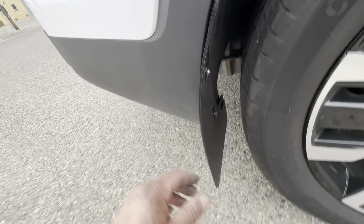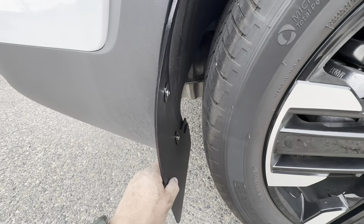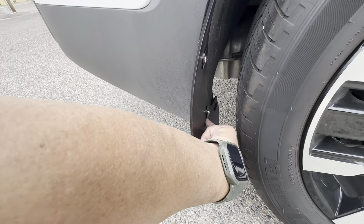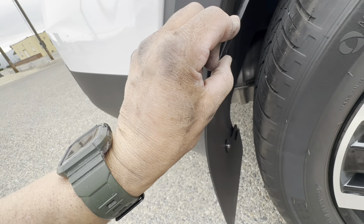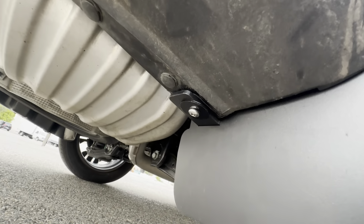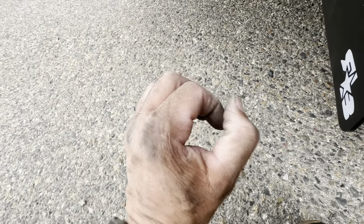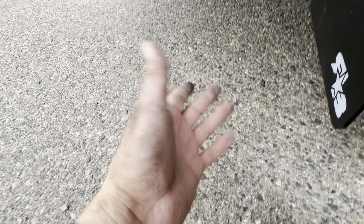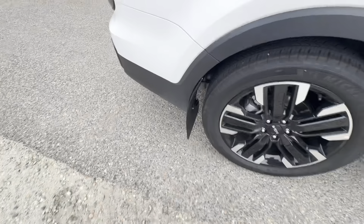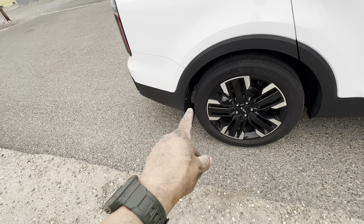Got them installed. The rears kind of just flop like that, which is fine. They take two screws here — the bottom screw and this upper screw. It would have been nice to have another screw up here, but not too worried about it. These clips that screw in there — go easy with those. I stripped this one out, the little metal rectangle thing. I ended up having to put it on the ground and smash the thread — it's a spiral deal. Had to smash it in so it'd be tighter. Just be careful with that. It doesn't thread as much as the upper screws — you only get about three threads on that bottom one, whereas the upper ones you get almost a full screw.